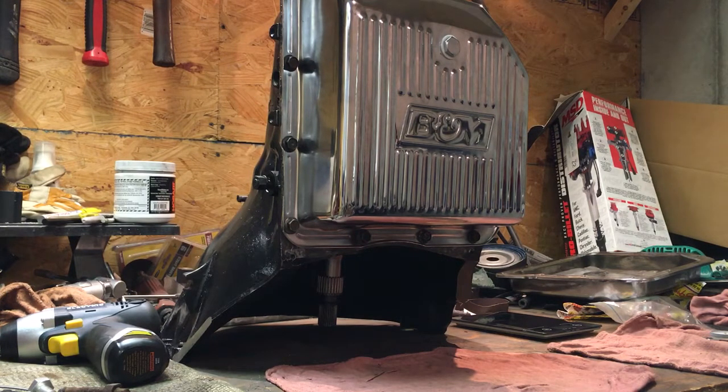Anyway, I want to put a little thumpy-thump cam in my engine, and because of that I'm going to filter all the fluid coming out of my Winner's Choice 3500 stall converter. As long as I can run it through a paint filter and find absolutely no debris, I'm going to put it in this transmission, because the only failure in the other transmission was that I rolled a sprag. So hopefully there's no debris — if there is, the 2200 is going in, no questions asked. That's where I'm at on my rebuilt Turbo 350. Thanks for watching — we'll keep building and turning wrenches until we can make some noise!